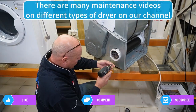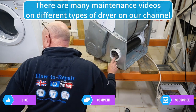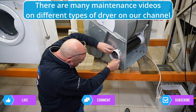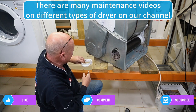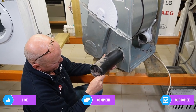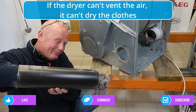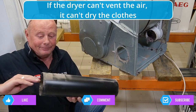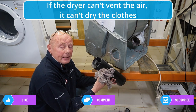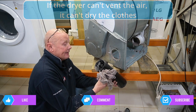This is the vent tube and I can see it's really blocked. On these models of machines, it's just got a couple of pins — one screw and a couple of pins — and this will come off. It normally twists, and that comes away. Then you are able to remove the tube. And if I just push this out... get my point? That's what came out. If a tumble dryer can't vent the hot air, it's only going to steam the clothes. This is why it's so important to keep your machine in good condition.